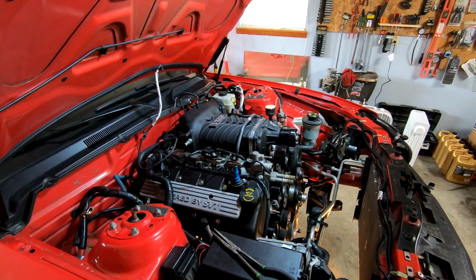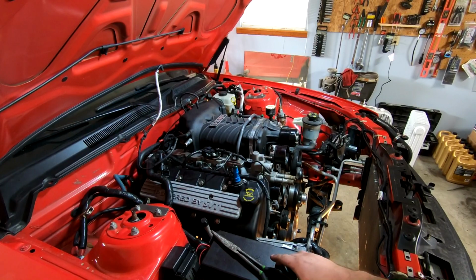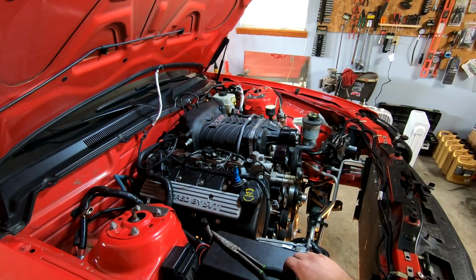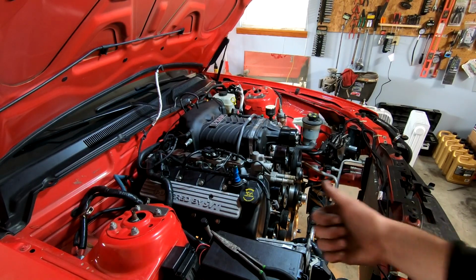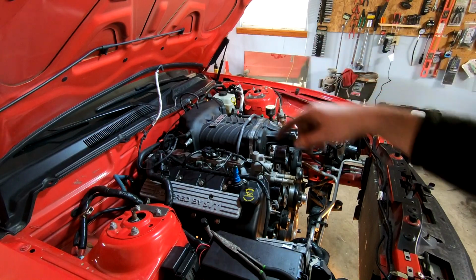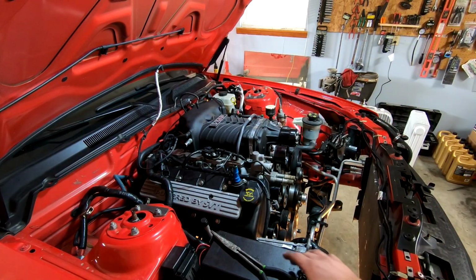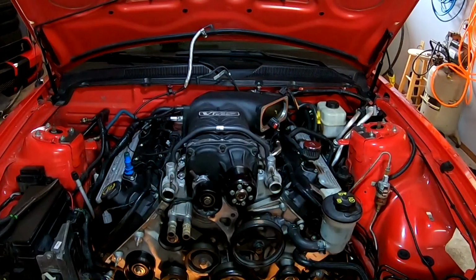All right, so now we're gonna go ahead and install the 10 supercharger bolts, 9 in my case. Basically doing a cross pattern back and forth, and they want them done in two stages, double check. So first stage is 44 inch-pounds for all of them, and then 18 foot-pounds for all of them. So that's what we're gonna go ahead and do.